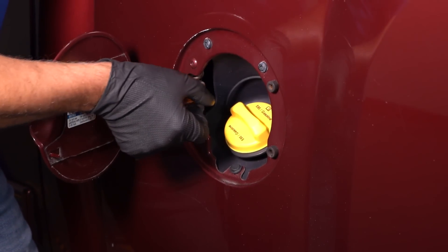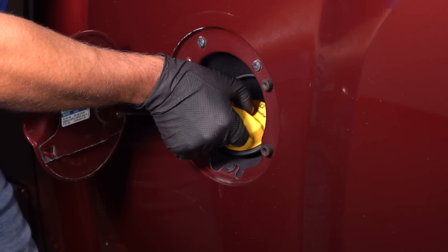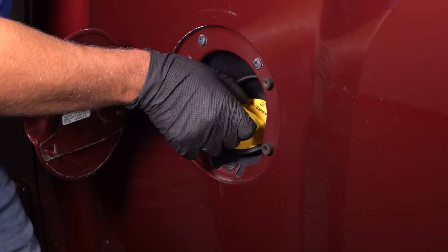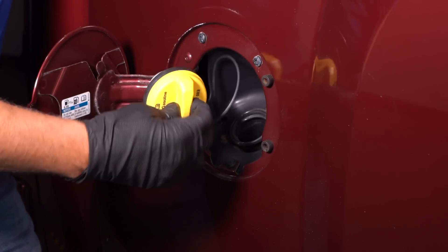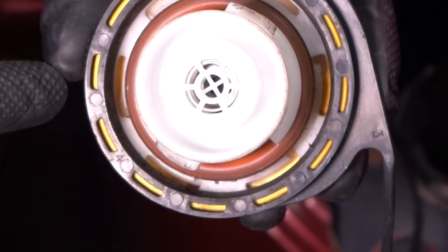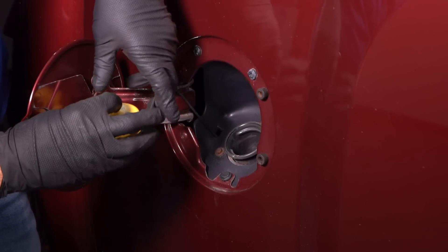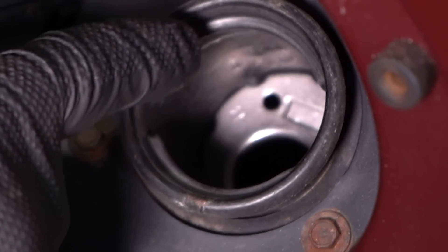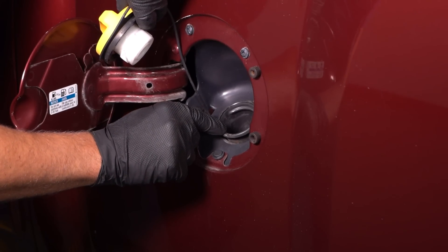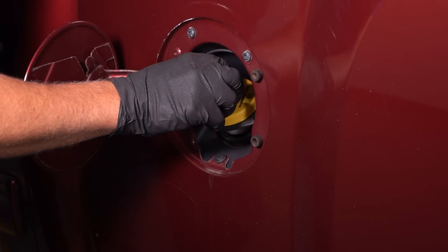Open the fuel door. Grab the gas cap — you don't want to just automatically start tightening or loosening it. See if it just pulls out, see if it's that loose. If not, then you can loosen it up and take a look at the seal. See if there's any cracking in the seal. If there's any cracking, that could be a simple gas cap replacement. Also, check around the rim where the gas cap seals and see if there's any rust buildup. There's a little bit of rust right here, and if it's built up enough, it's going to cause a leak and you're going to get a check engine light.